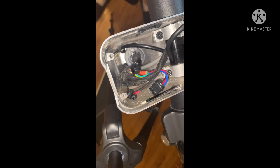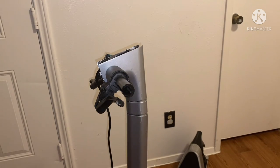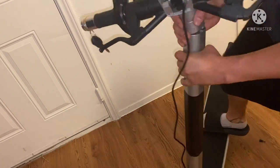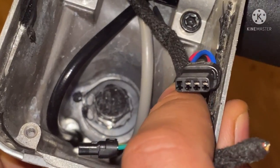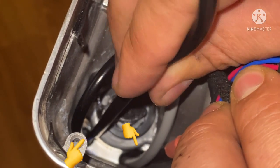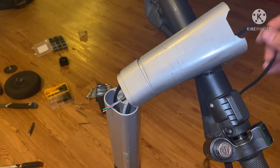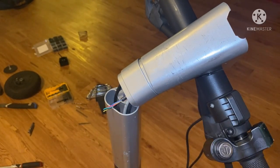Now let's go ahead and try to break that bolt free on the bottom. I broke this loose using a half inch ratchet and a 16 millimeter socket. Now what I'm going to do is fold this in half and feed my wires through the bottom. I might not be able to get this part on camera, but my cable going to my twist grip throttle has got to go down one of these sides — left or right. Once that goes down there it'll start getting easier. I'm going to get this down into that hole, snap this in half, pass it through, and go from there. I fed my wire through this top part down to this little spacer here and now I have the end broken out.